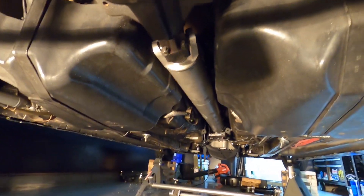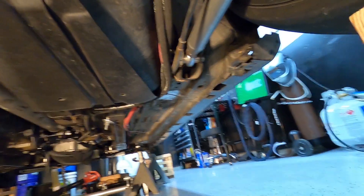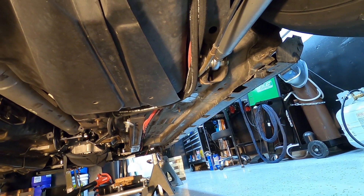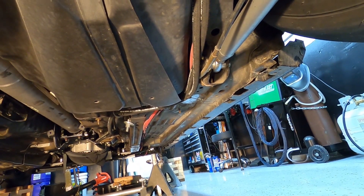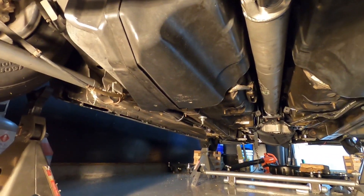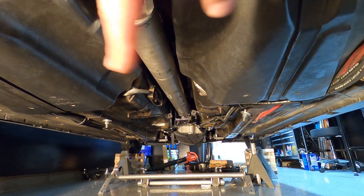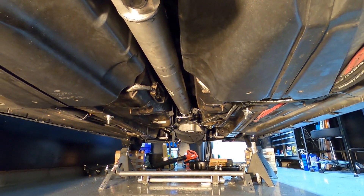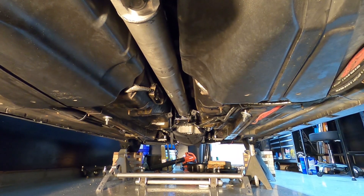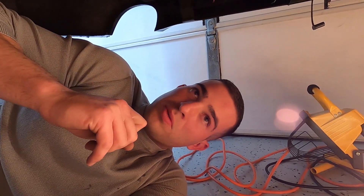It ties in right there to the bottom of the cage — the six-by-six steel plates for the main hoop are right there on that spot, and the same on the other side. So I'm going to go directly across up there on both sides, right in front of the fuel tank, and that's where I'm going to mount the front part of the wishbone. I think I'm going to split this up into a couple of videos to make it more digestible.